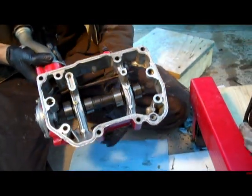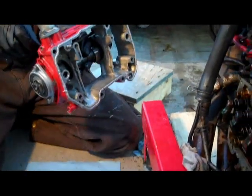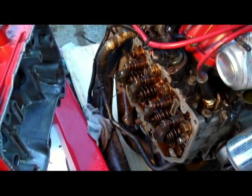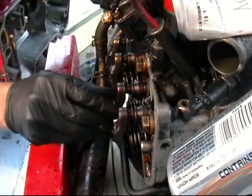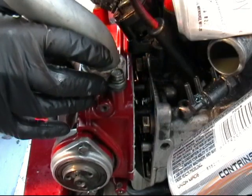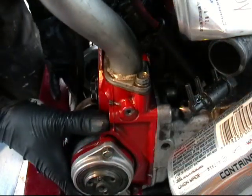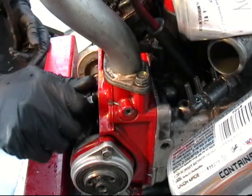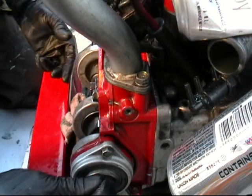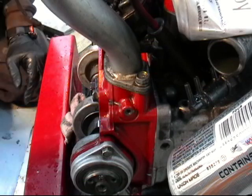Now our cam tower is all set up with the gray compound. I'm ready to install the cam tower onto our head. I've got our rockers in place, our O-ring in place, and I'm going to have a bolt on standby to thread through and give it a little bit of thread to hold the whole thing on. This is the kind of operation I want to accomplish in one move, which is why I would pull the engine first — the time it takes to pull the engine saves all the frustration of doing it in the car. Our cam is in neutral since the dot on the pulley is facing up.